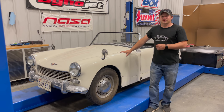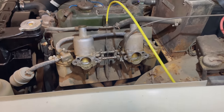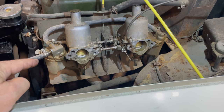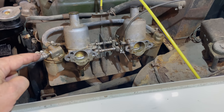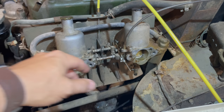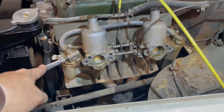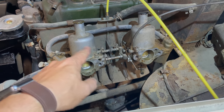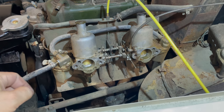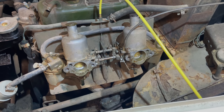First we need to get them out of the car. I didn't put the air cleaners back on because I knew I'd have to adjust the carburetors. Removing the carbs is actually pretty simple — you just need to remove the choke cable, the throttle cable, the vacuum line, and the fuel hose. Then there are just two bolts behind each carburetor. I leave the linkages in place and take both carburetors out as one piece.